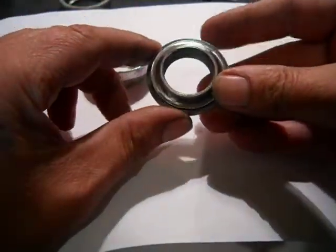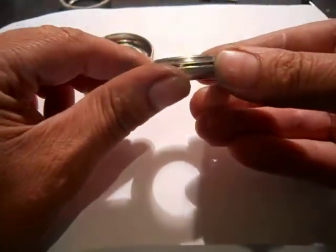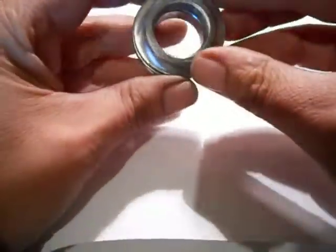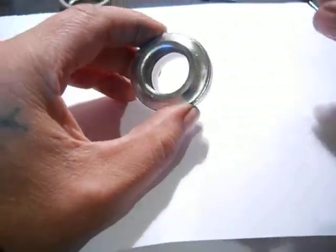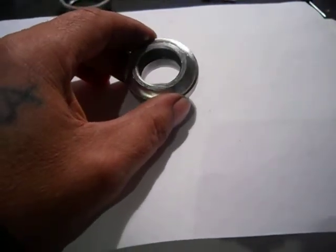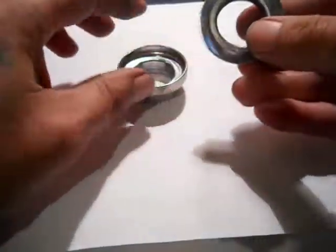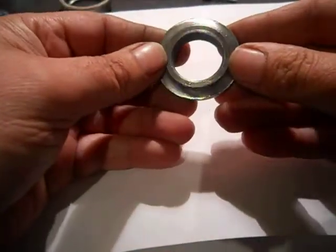It was one of the expensive wheels — I don't know how many spokes it was, it was kind of blue colored. That blue in the 90s on a little 20-incher. I haven't got the bearings out of the gas yet — they're soaking. I will wire brush the cage too if they're rusted. You've got to be careful — you'll rip the bearings right out of that little tin cage that holds them. I'm sure if anybody's into bikes, they know what a bearing cage is.